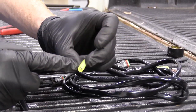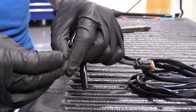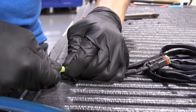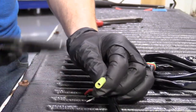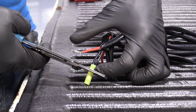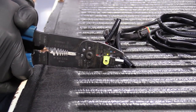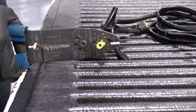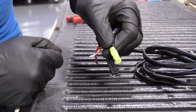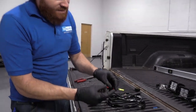Let's try something a little different — we'll go with one of these other connectors. We're going to put our wires inside; they'll need to be a little shorter. Just twist as you push it in. Crimp it down in the yellow there. It's important to make sure you've got a little bit of metal coming up past where your crimpers are going to be. Give it a nice tug — yes, that's much better. You always want to tug-test it because if you have a loose connection, your LEDs will flicker driving down the road.